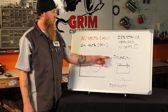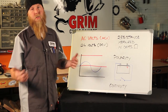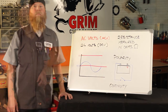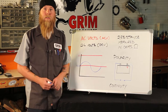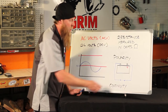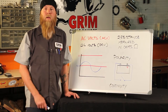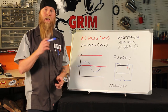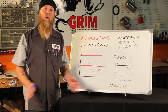Another important term would be polarity. Polarity simply means the direction of current flow, whether it's AC volts or DC volts. Conventional electrical theory states that electricity flows from positive to negative. The next thing we need to talk about is continuity. Continuity simply means the ability of a device to pass electricity — it either has continuity or it doesn't. A closed switch has continuity, but if I open it, it breaks a circuit and it has no continuity. A good example would be your kill switch: when your kill switch is on, it has continuity and is passing voltage to your coil. When you flip your kill switch off, you're disconnecting that switch and it has no continuity.